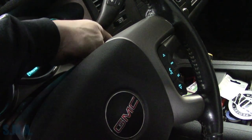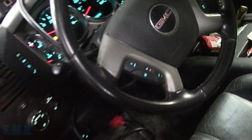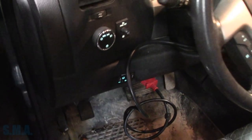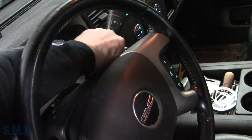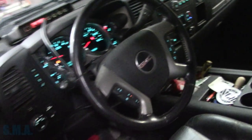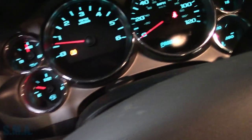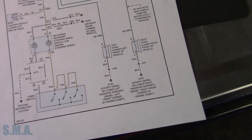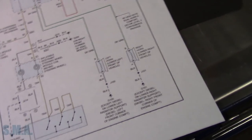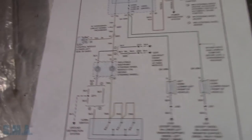Hit the clock three times - that's good. At least I didn't have the oil all drained out of it. Reach in and hit the brake pedal - that's good. So that tells us they're probably tapped into the horn wire and it's broken or something. Why won't that shut off? Step on the brake - key's on. Stupid aftermarket junk. Anyway, looking at our newly acquired knowledge, what can we say that we know? That just cut our testing methods right in half, folks.